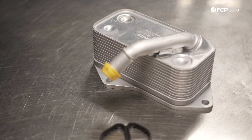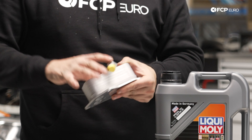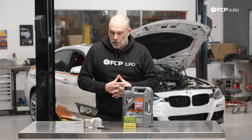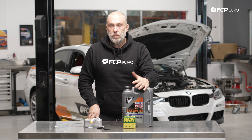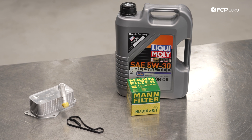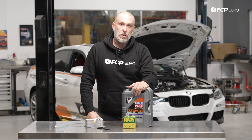In this car's case, coolant is basically leaking out of this sandwich plate — you can see it was spraying everywhere. Pretty common failure, so we need to go ahead and replace that. While we're at it, we're also going to change the oil. We'll drain the oil, and we also need to drain coolant to do this because coolant flows through it. With that said, let's talk about the tools we need for this job.